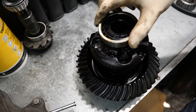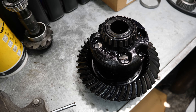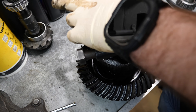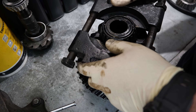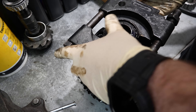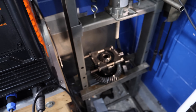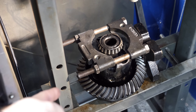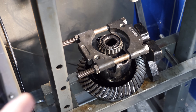These look correct. So the new carrier bearings from AutoZone — believe it or not, not Rock Auto — turned out to be correct. This guy's going to be hard to grab. I'm going to try it with this first, though. There's no space under it like there is with the pinion bearing, so chances are it's going to rip the cage off. But if it does, I'll have to come in here with a grinding wheel and kind of cut the race off. It's been a while since I did a diff. I can't actually get under there to press that off with the gear on there. Even with that off, I don't even think they're going to clear the carrier.